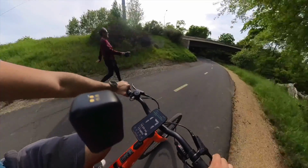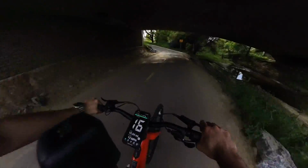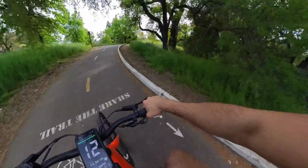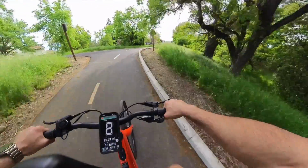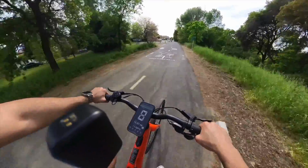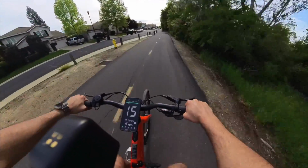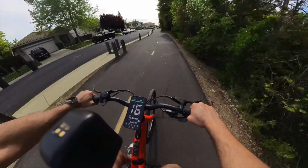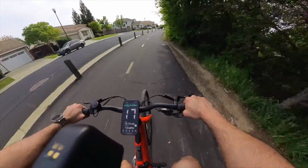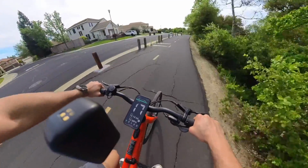And when it comes to riding up high steep grade hills, 9% grade, that's a fine example, it does slow down the bike a little bit. The 45 Newton meter engine that it has in the back does allow me to maintain speed, but it still requires me to do some pedaling, I noticed. So if you live in a very hilly environment like San Francisco or something like that, this engine is slightly less powerful for that. So I'll recommend looking into the Discovery 1 or something with a more powerful engine. If you barely hit some hills and stuff like that, this is perfectly fine.